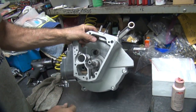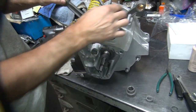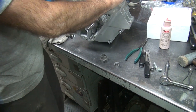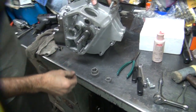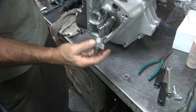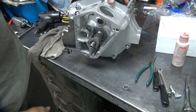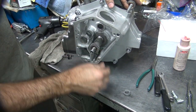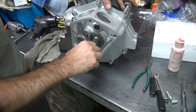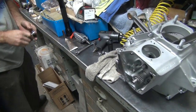See how the key's up in there? The pump is rotating easily so it's not locked up. Now take your spacer, put that on there. Keep rotating forward — if you unscrew it, it goes the other way. Then take your second key and put your cam gear in there with the key up. Rotate until you catch it — when you go on it drops in. Sometimes you have to tap them lightly and they pop on. And you've got your nut right here. These are reverse threads, so you have to go like this. You can put Loctite on there if you feel like you need it, but you barely need it — can't think of any reason why you really need it if you tighten it down.